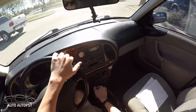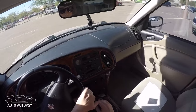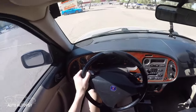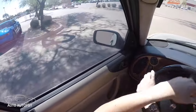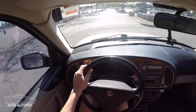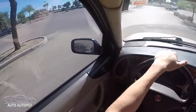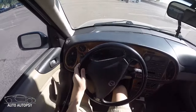One thing you don't want to do when sitting at a stoplight is have the car in first gear just ready to go. Keep the car in neutral and keep your foot off the clutch pedal, because riding the clutch can wear it out and ruin it. That was a bad habit I had at first — I always kept the car in gear because I didn't want to panic. Just remember: keep the car in neutral, and when the light's about to change, put it in first, clutch in, and start off like normal.